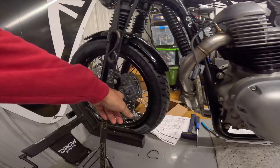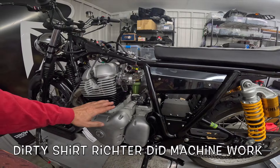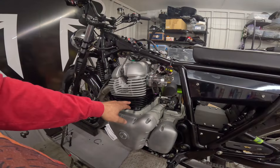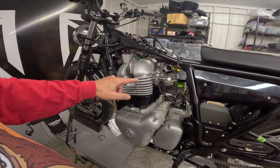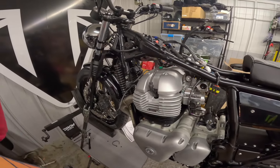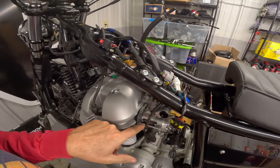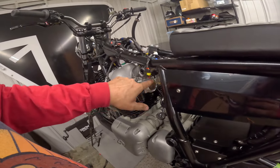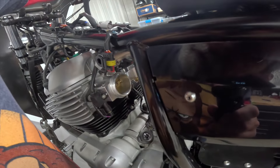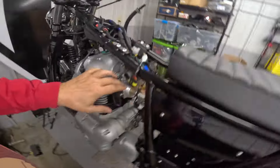Check this out — Brembo. It started as a 650. They bored it out with an 865 big bore kit. They put in S&S 11-to-1 compression pistons. They've got this Revelry Racing head that's ported and polished, really opened it up. Then they also put in this Revelry Racing throttle body — I think they're 40 millimeter. They're larger than normal. You can see them moving in there. Isn't that cool? So, larger throttle bodies.